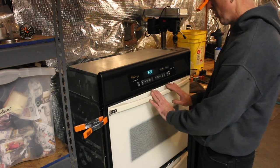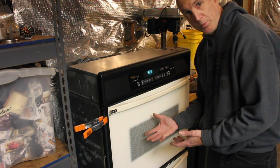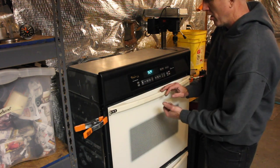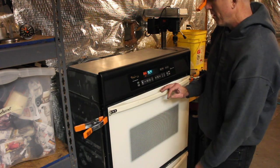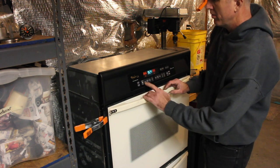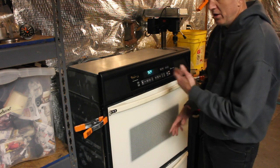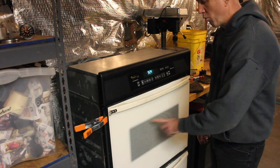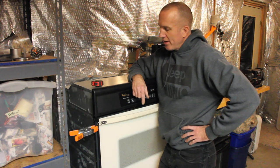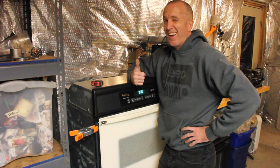Now I have complete control over this. I just never want to use the broil function because the broil isn't hooked up to anything. I wanted to keep control over the upper and the lower oven and still have the convection, so I can set the upper oven temperature, then the lower oven temperature, and if I want I can turn the convection on the top, hit start, and I could turn the upper oven off or the lower oven off independently. It gives me a lot more flexibility instead of just running one unit. And there you have it — that's how you take a double wall oven and convert it into a single powder coating machine. Like and subscribe. Let's keep the CJ7 world going.